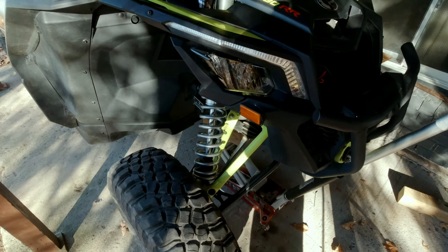I've made those adjustments to the rear — exact same procedure as the front: broke free the jam nuts at the top, jacked the car up to get the weight off the spring, screwed down the preload collars about a quarter inch, dropped it back on the ground, rolled it back and forth, and rocked the suspension to get it to settle. After rechecking, I actually overshot almost a quarter inch — I'm not going to worry too much about that because I expect the springs and suspension to settle a little over the first one to three hundred miles. I'll take it for a couple drives, bring it back in, recheck everything, and fine-tune. Now we have one more job to do: set the crossover rings to the proper position.